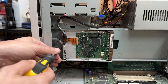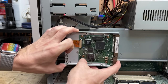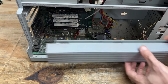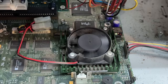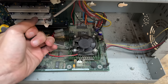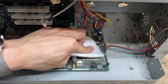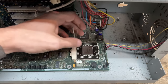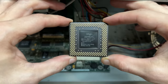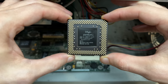While we're on this side, let's get that hard drive out of there — looks like we just have a single screw, then this must do a slidey thing. Now let's get this side's rocker panel off so we can more easily access that CPU. That fan seems like a survivor. They actually used thermal paste — my hat is off. Let's clean that CPU up and get it out. That's an Intel Pentium 1 with MMX tech — the SY060, I think that's a later revision of the first stepping, which puts the clock speed at 200 megahertz.